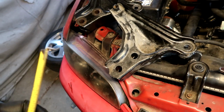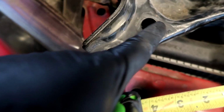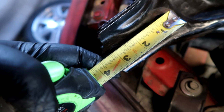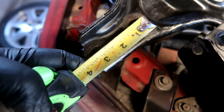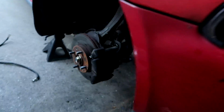The automatic rear T-bracket has the bolt holes closer to each other, so this is the automatic. This is what was provided, and if you look, we're at about 3 inches, give or take, from the top of here to the bottom. But over here, if you look, we're at about 3 1/4, and that was kind of the amount that I was far off as far as bolting the 19mm bolt to the transmission goes, and this is the correct one. In the meantime of waiting, I installed the axle, the forks, the suspension stuff on both ends, just to kind of get that out of the way.